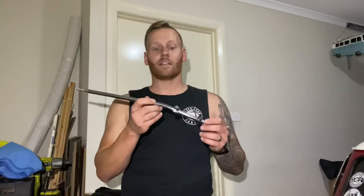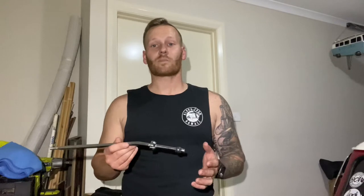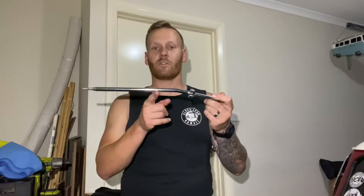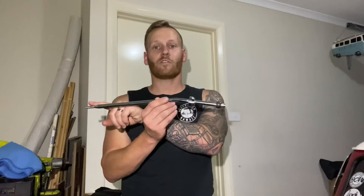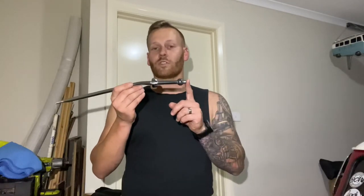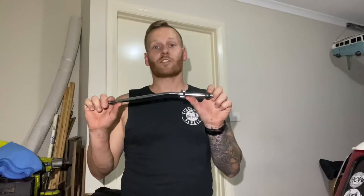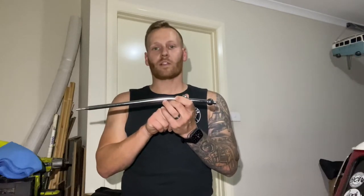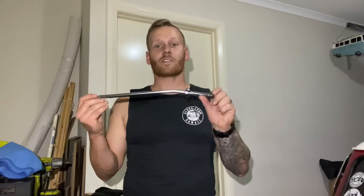So this is our new gear lever. The difference is the fulcrum has moved up a little bit further from the old one. A little bit of physics: if you imagine a straight piece of steel with the fulcrum — the pivot point — directly in the middle, and you apply five kilos on one end, you need five kilos on the other end to keep it balanced. Now how a short shifter works: if we shorten the distance between the load and the fulcrum, the effort becomes shorter, which creates a shorter throw. If we flip it the other way with greater distance between the load and the fulcrum, a great deal of effort is required to move it — the opposite of what we want.